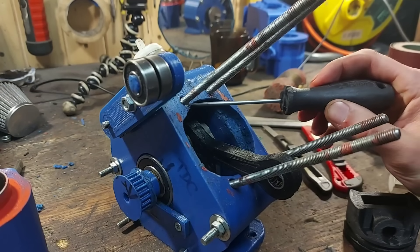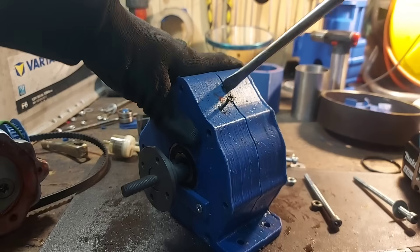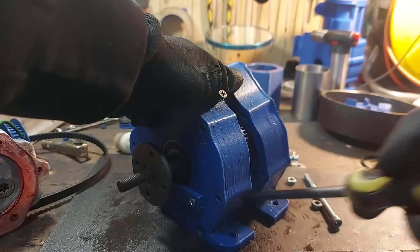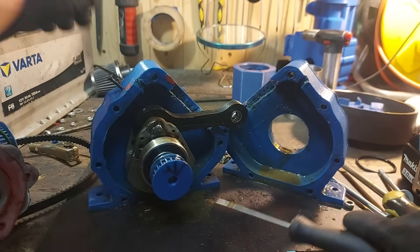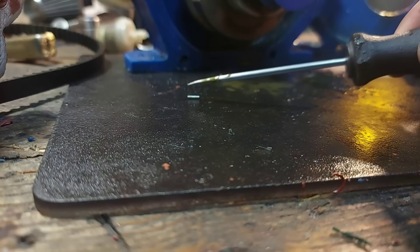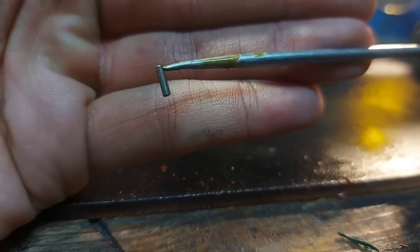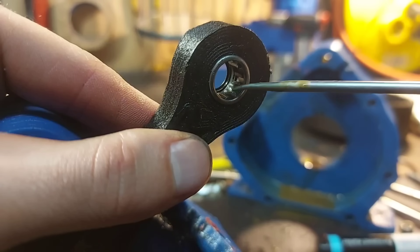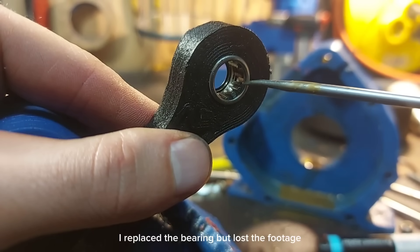But first I will have to address this sketchy crankcase I improvised in the last episode. I started by disassembling it and inside I found a part of a needle bearing. I checked the small end to see if the bearing was missing any parts — and the answer is yes. I think this is where the knocking we had in the last episode came from.